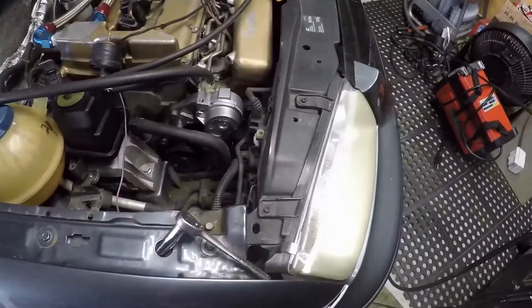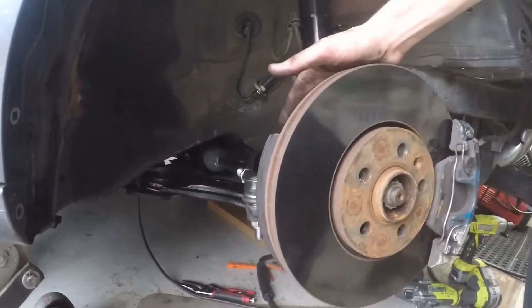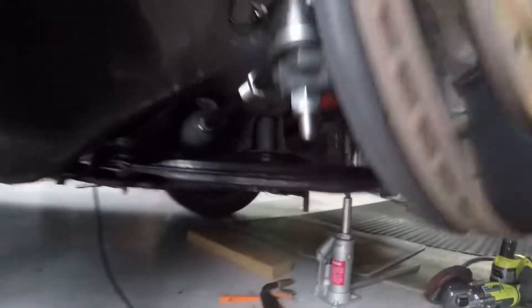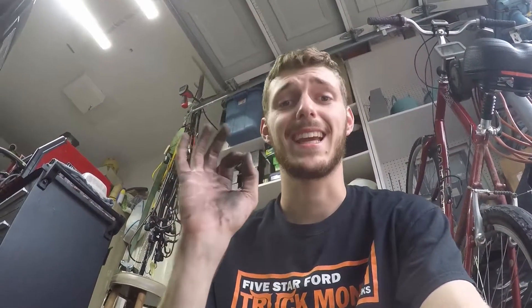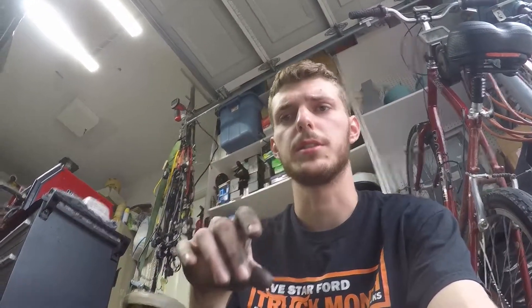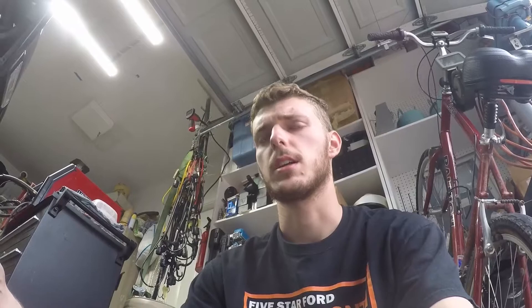I got my two motor mount bolts cinched down, motor's in place, control arm is replaced. All I've got left is to weld in the little window I cut to get to that bung. I call it a bung because that's really the only thing I know to call it. I laid down a significant amount of weld — way more than factory, which probably just does two small opposing quarter-inch tacks. I laid down a little over half the bung with weld, so it's not going anywhere — it's probably stronger than the other side. If you ever run into this issue, you basically have to do this exact same thing. It's a pretty annoying process, but with a welder it's doable.